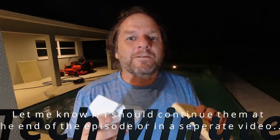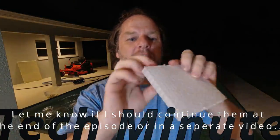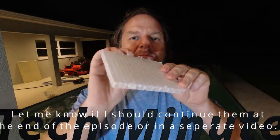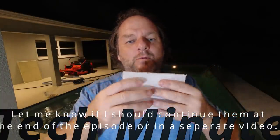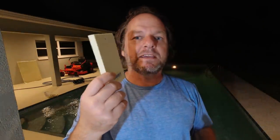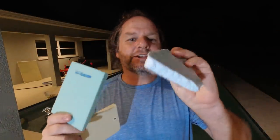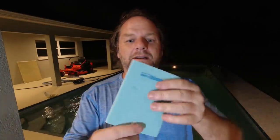For the interior: the current interior of the boat is built out of a wood honeycomb — they've got a wood veneer with a resin-infused paper honeycomb, very similar to this but it's paper. It's pretty lightweight. But I don't want to go for the wood look; I want something a little more modern. So I'm probably going to use PET foam for the interior. I'm not even going to use polyurethane or styrofoam — I wouldn't even consider styrofoam. Polyurethane, people have done it with mixed luck. I might use honeycomb — I'm going to do some more experiments before I make my official decision.